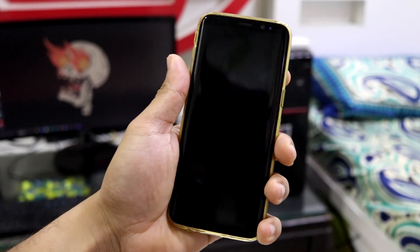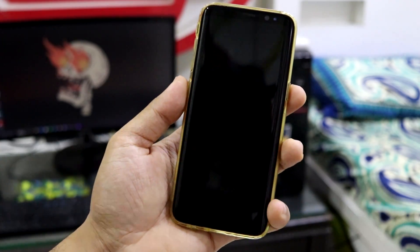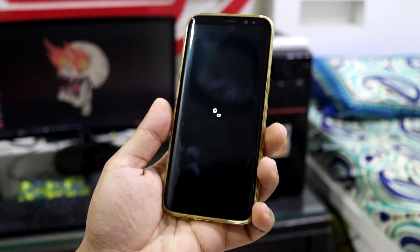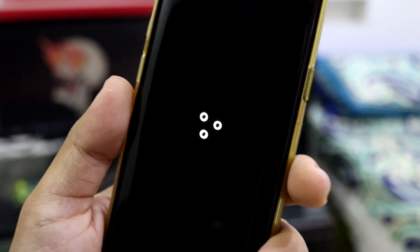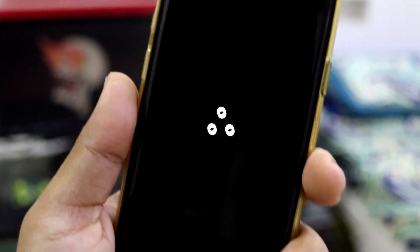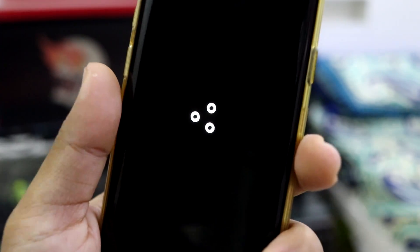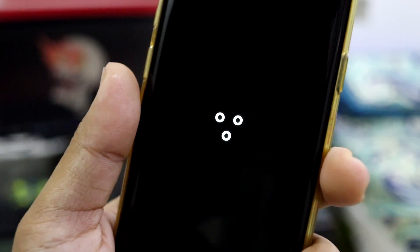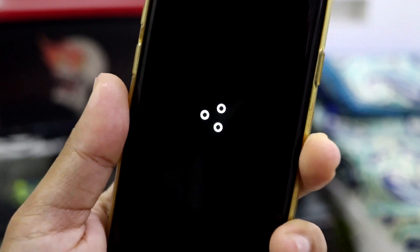Now just reboot the system. If you want to install Magisk, I'll give instructions in the description below — you can add the ZIP or install it after boot. The Lineage OS boot animation should appear, which means you've successfully installed Lineage OS. Make sure you flash GApps right after flashing Lineage OS — don't boot first and then go back to GApps, as it might break things. The OTA updater also supports add-on scripts, so Magisk and any modules you have will be automatically restored after updates.